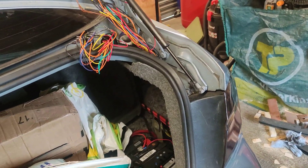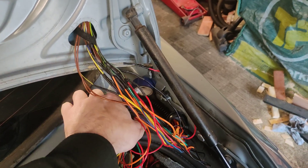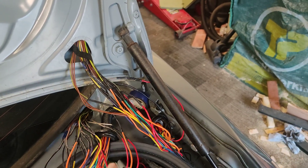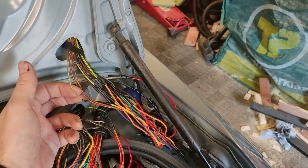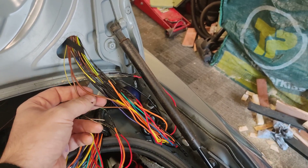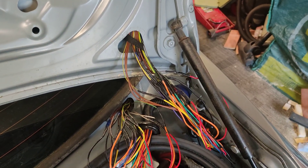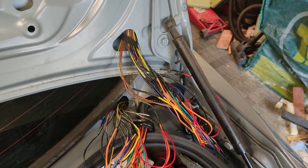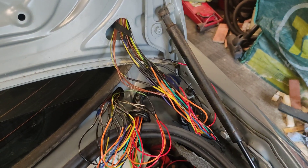I'm going to give you some tips to help you make things faster. What I suggest is, if you pull the loom off both ends, cut one wire and pull it through the bottom. The first couple of wires are going to be a pain, so go for unique colour wires — ones with stripes or anything distinctive. Avoid the brown wires at the start because they're all the same colour and you could easily get confused.